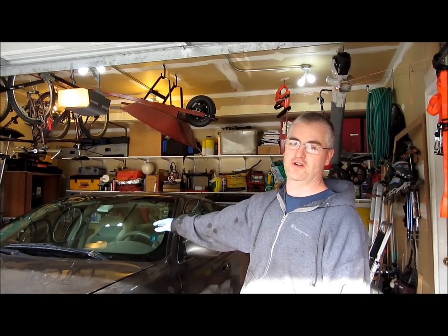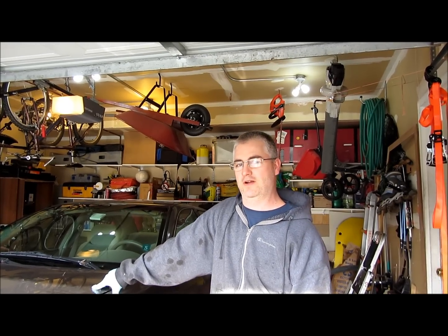Hi, I'm Mike, and today we're trying to diagnose a bad wheel bearing on this 2001 Oldsmobile. And what I did was I jacked it up, I put the car in drive while the engine is running, and I got underneath the car and I listened to the wheel bearings.